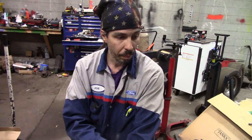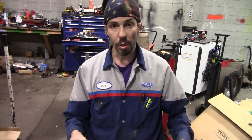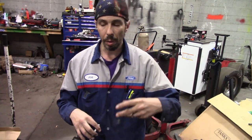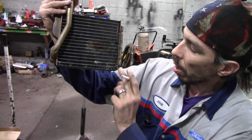This car - he bought it probably about a year ago, so he's been going through this since day one. It's never ran right, never been easy to start, always giving him fits. It was doing all kinds of craziness when you tried to start it - popping through the intake, backfiring, shutting off, just a mess. You couldn't keep it idling. Then once it warmed up a little while, it would run a little better and it was drivable. He finally got it down here just in time for the heater core to be leaking all over the place.